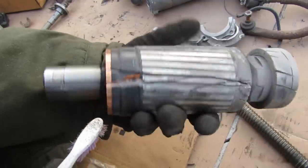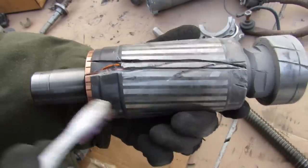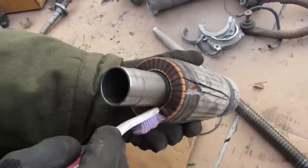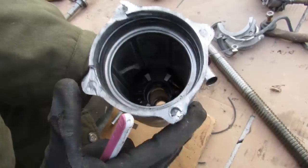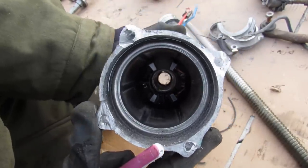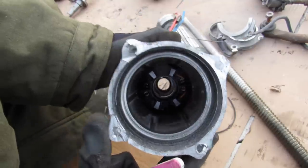The field coils in the motor give you an idea of the thickness of the gauge of the wire wound up in the coil. You've got the brushes that contact the back surface and continuously rotate it. Because this is a brush motor, the brushes themselves could sometimes wear out, but the EPS motor is typically not used that much and I see it outlasting say an alternator or a starter.